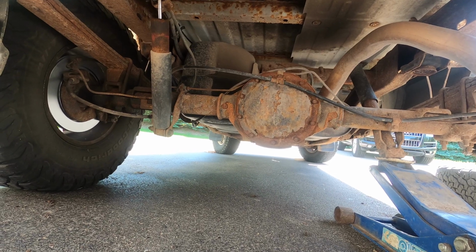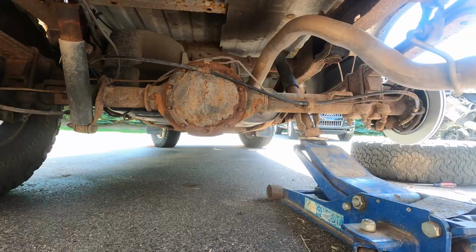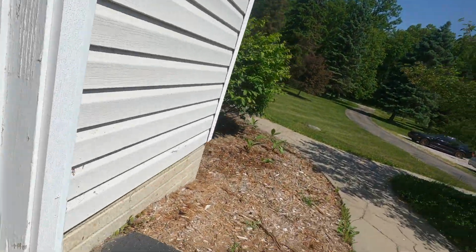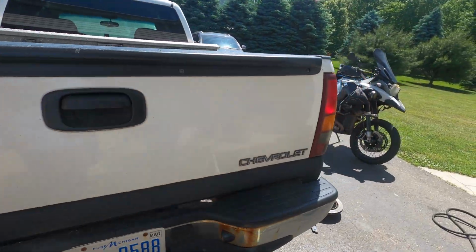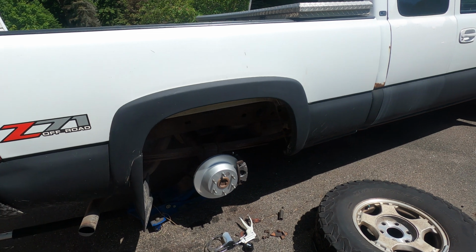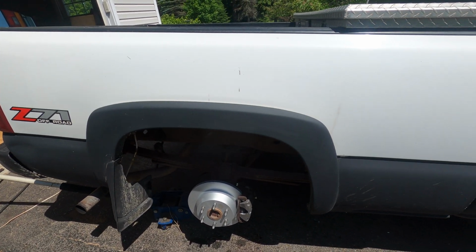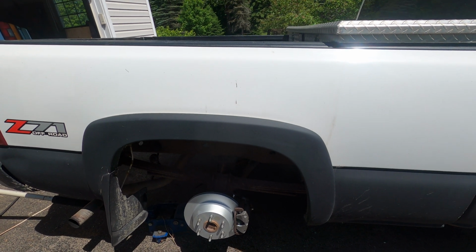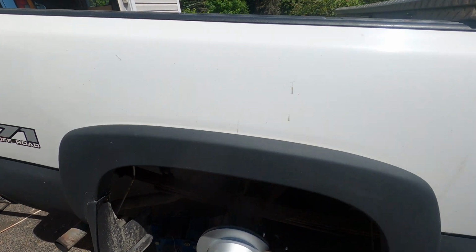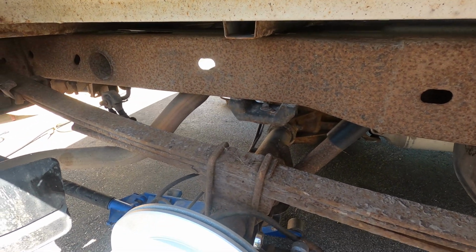Well, now I'm even less worried about the part where I unplugged the fuse because it was freaking out and we tried to run into stuff. So the speed sensors in the wheels get rusty. And then me and my buddy Steve were going to the parts store for some other stuff, probably his truck, who knows. And if the little curb wasn't there, we would have put this thing right through the wall. The ABS came on and it wouldn't stop because it thought the wheels were spinning. So we promptly opened the hood and unplugged that fuse so that it doesn't try to kill us anymore. Because I'm not willing to go through all these wheel bearings to try to find the one that's not working right.